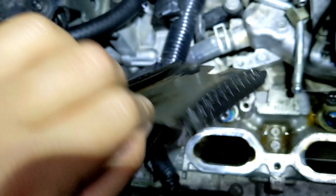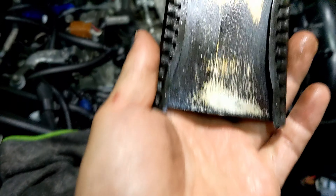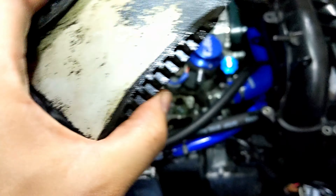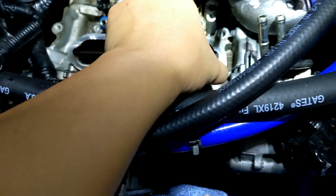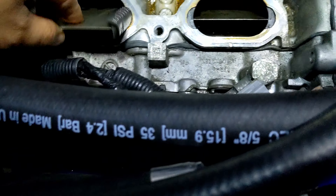I have to be honest — the carbon buildup isn't as bad. If you guys remember when I did this last year, I cleaned it up as much as I could and I've been running full E85 ever since. I did a half-assed job cleaning it — all I did was spray brake cleaner and wipe it off, about two bottles. But not bad at all. For some reason I still can't take off these injectors.